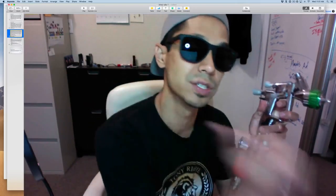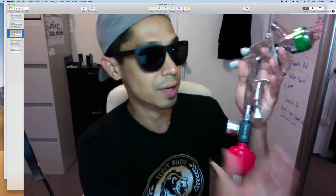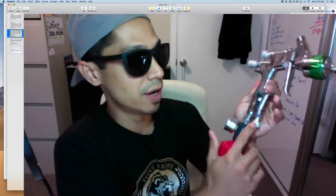That's basically my answer — 29 PSI is pretty high, you're on the high side. Anywhere from 25 to 29; 29 is on the high side when you really want to atomize that clear coat. 28 is a good pressure; 26 to 27 is pretty much average where you want to be. 25 is good for single stage paint jobs. Keep that main air inlet wide open no matter what spray gun you're using — I never adjust with that knob.